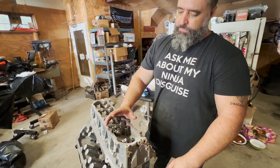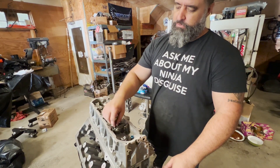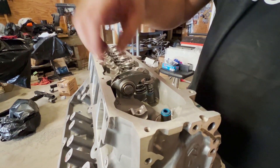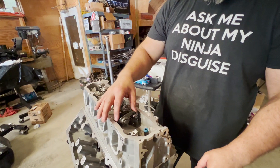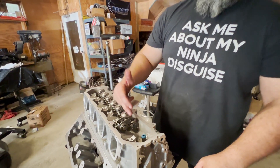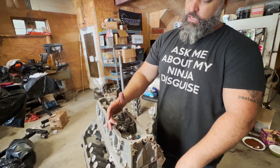So: checker spring, rocker arm, solid lifter, push rod long enough. All you're gonna do is tighten the rocker arm bolt down — not 22 foot-pounds, just until the push rod and the valve make contact. You should still be able to rock it back and forth, especially if you have a hydraulic lifter that you haven't modified.